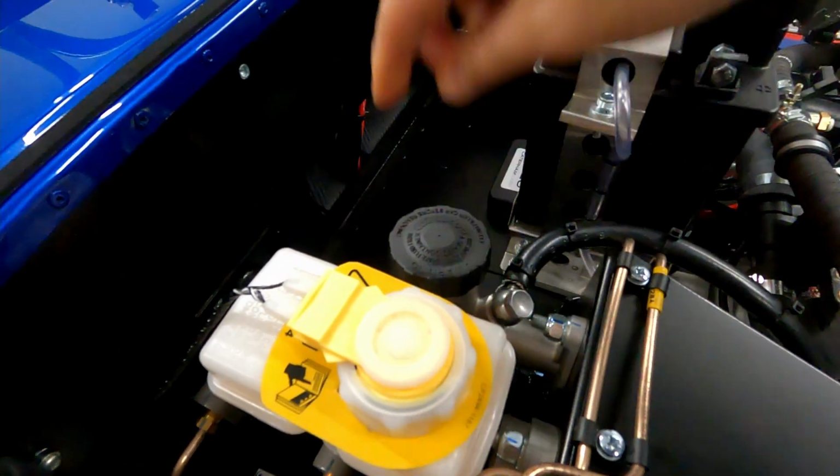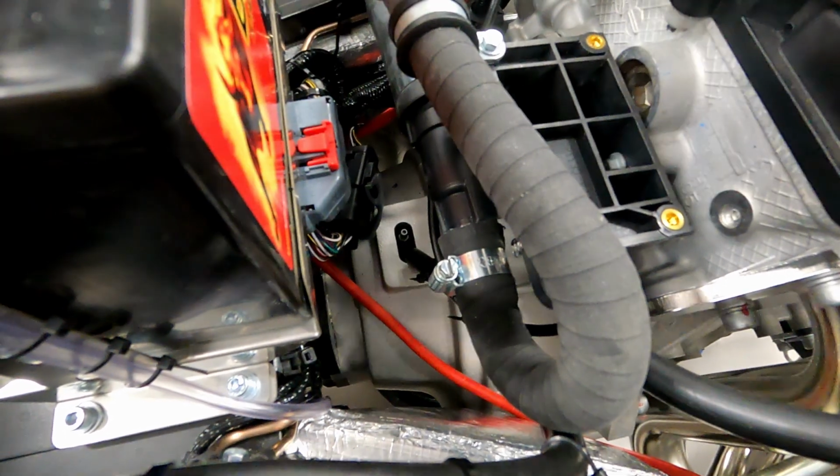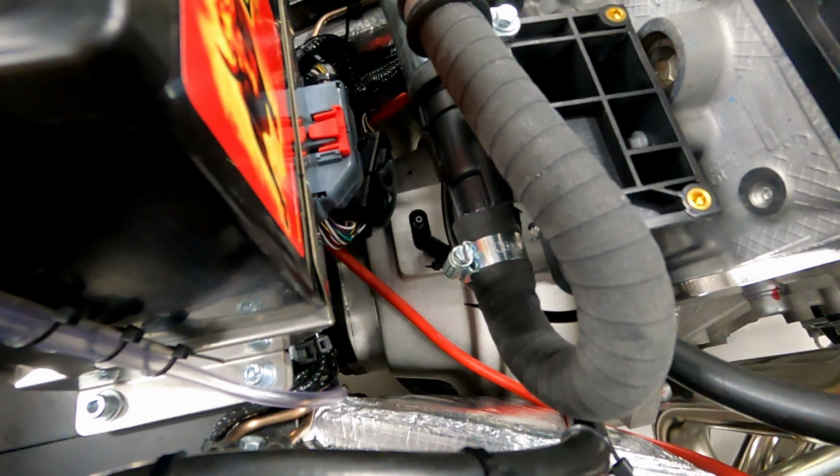I then had a bit of difficulty here with the clutch. So you can put the fluid into the clutch. And this here, which you can just see at the end of my fingertip, is the bleed nipple for the clutch. But on everybody else's blog, that's a good inch higher, which means you can get a spanner on it and ease it off, close it, open it, close it, and let the bubbles flow out into a receptacle. Mine is sunken way below the casting here, so I cannot get a spanner in there at all.